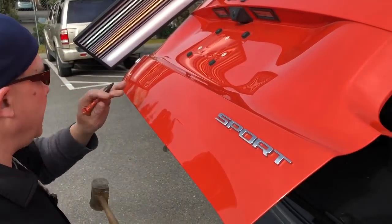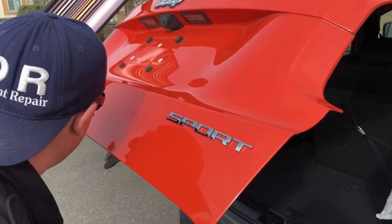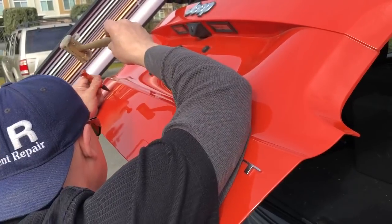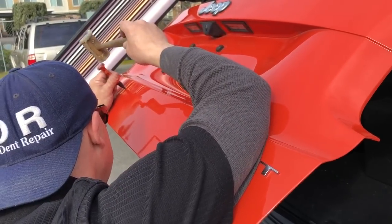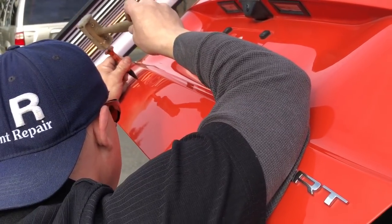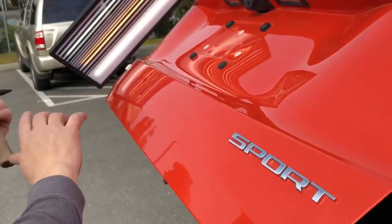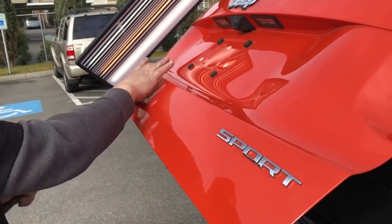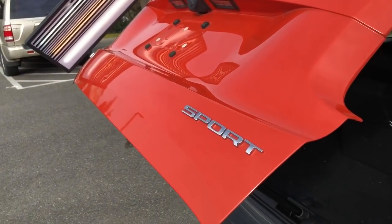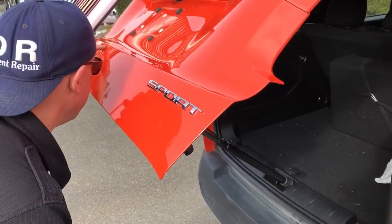Yellow and orange paint — I don't know if you guys can tell, but yellow and orange paint is one of the toughest to see a dent in because it just eats up the light. The customer is well aware that it might not be 100%. But the way orange kind of eats up the curves of the light — this is just a little panel that we need to get straight. I'm sure we're gonna get it looking real good even if I have to break out the heat gun and tool it up a little bit.